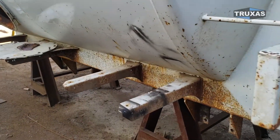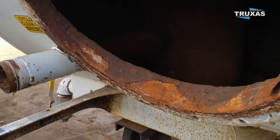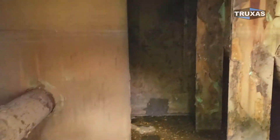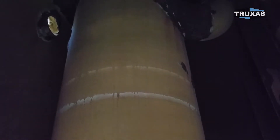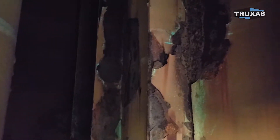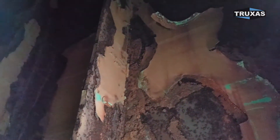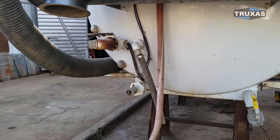Go ahead and look in the tank here. We will be re-epoxying this tank. Right now it has surface rust on it — no real deep-set rust. That's just dirt covering the epoxy, so all the epoxy is still on that part. But you can see it would help to flake all this off, shine it up real good, and put a fresh coat of epoxy on there. Definitely worth restoring on this Tornado vacuum tank.